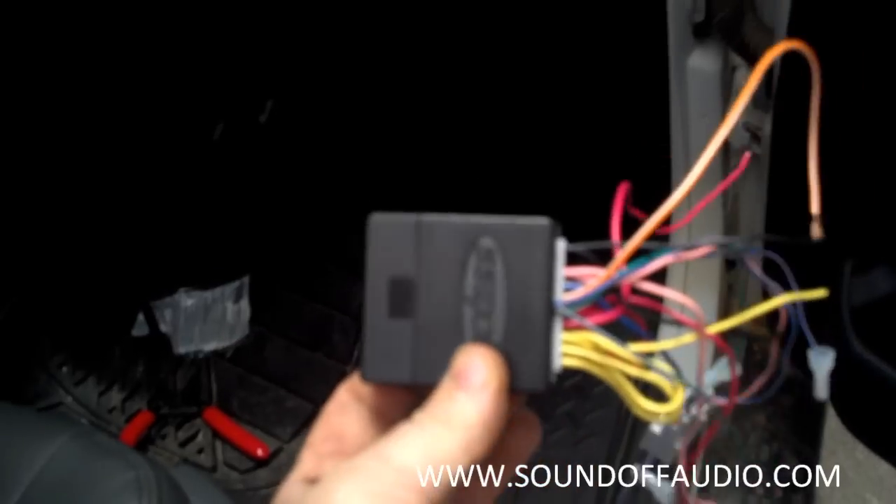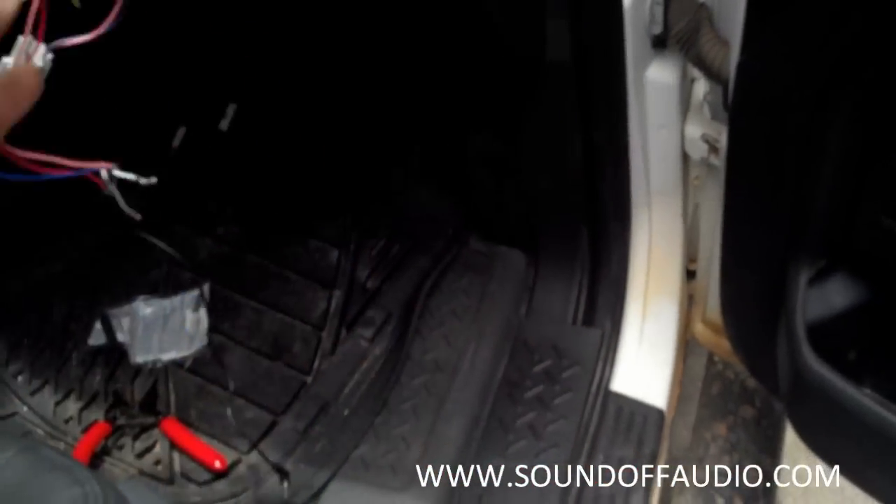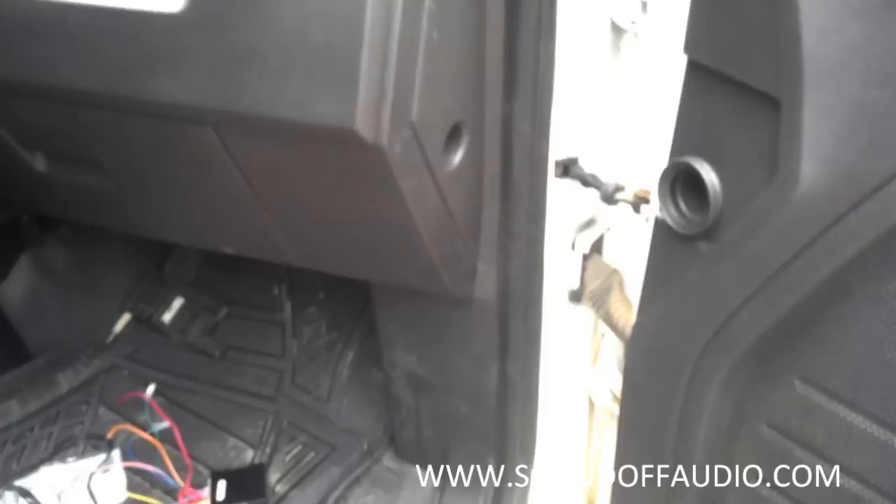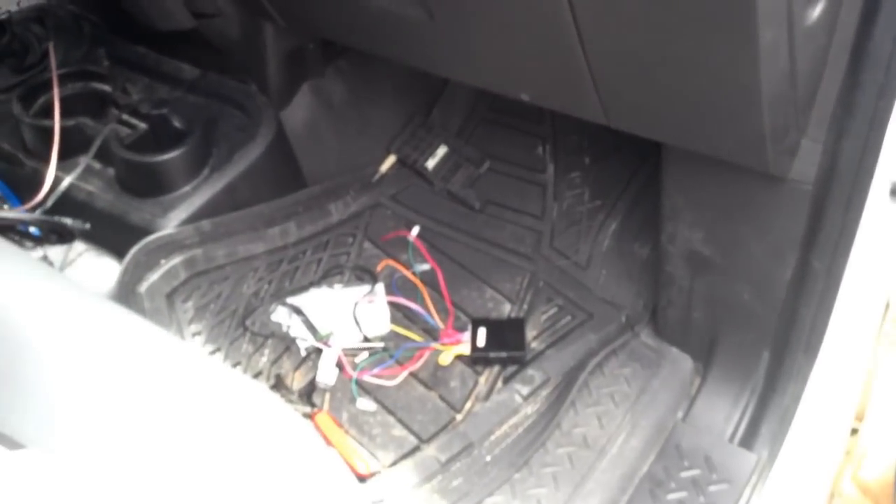FWH-692 is the American International harness for the dash. You get that harness and just run your wire to fuse number 32, and you won't have to put up with all that hassle.